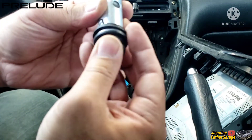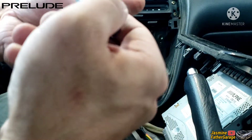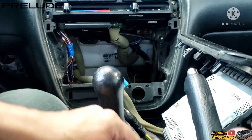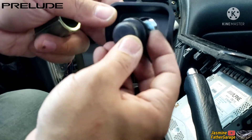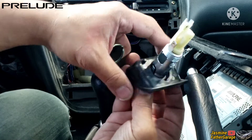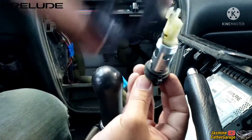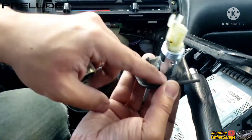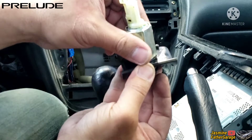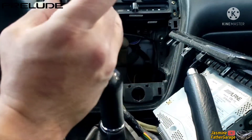Just close it like that — it's not gonna go anywhere. Then put this bezel on. See that tab again right here, make sure that's facing down compared to the tab right there. Nice and smooth. And then this nut locks everything in place. So let's put this in the dash and see what it looks like.